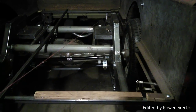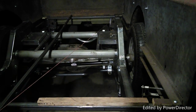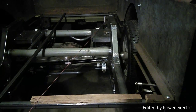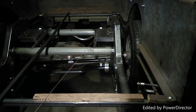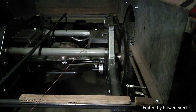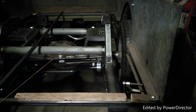One of the reasons I decided to go with diamond plate steel instead of a wood bed was because the frame was getting awfully close to the bottom of the bed. Not the rear end - that may be okay - but the spring perches are really close. Standing on top of where the wood would have been, I'm just barely clearing that spring seat. Without the wood there I'm hitting it, so if I put the metal plate right where the spring is, I can squirt silicone underneath and support the bed with those spring seats.